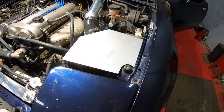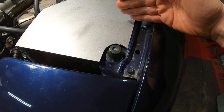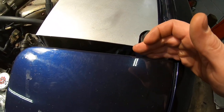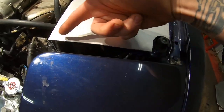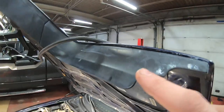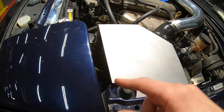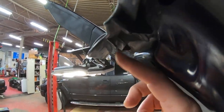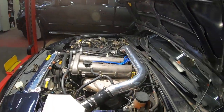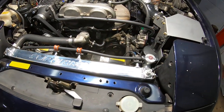On the topic of the filter box, we did have to trim it a little bit — we ground this section out a little bit because it was sitting too far forward and hitting this bumper. And then this lip on the front was hanging just a little bit too far forward as well and had a little bit of an angle to it, so we cut a slightly different angle and ground it smooth. The big problem was that it was catching up here — there's this flap that seals off the engine compartment. It goes right in that seam there, and it has some additional structure on the back of it that was basically resting on top of this and not letting the hood close. So a little bit of trimming there made everything fit a lot better. And then of course we got the radiator upgrade from Super Miata — adds a little bit of bling to the engine bay.